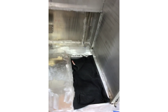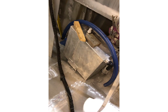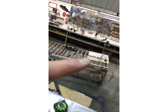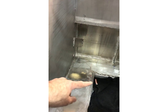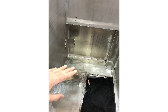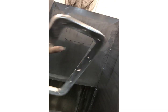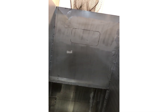In there is the head area — that's where the gray tank is down there. I have the tank built that goes in the back wall; it's 15 gallons, sitting right here. I've been placing and cutting and fitting everything. Down there is where the toilet goes — that's a little L-shaped seven-inch rise. It'll go in front of this tank and come out to that line. The toilet sits on that to bring it up to normal height. This here will get a five-inch bump out, and the shower column comes up along this corner. We'll get a porthole welded out there — I'm going to do that today, though I'll have to brace it so it doesn't warp.